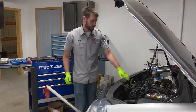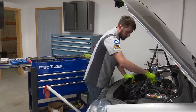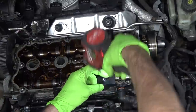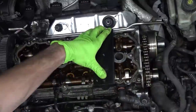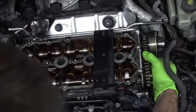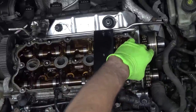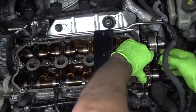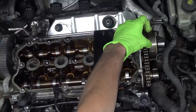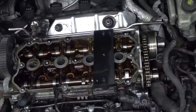You could get the special Volkswagen tool - whatever you want to do. I'm going to run it just snug because I believe that should be enough to hold. Then what I'm going to do is take the chain tensioner, pinch it together to get all that oil pressure out of there, and then I have a timing chain tensioner pin from a different job. I'm going to go ahead and insert that to hold our tensioner down. Then we'll be able to take this chain off once we take this pulley off. The phaser is intended to come off with the chain, so we'll leave the intake cam in there as we take the phaser off.